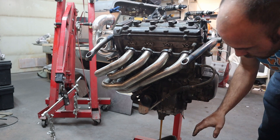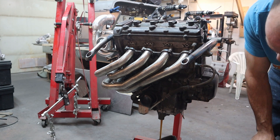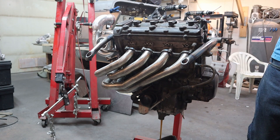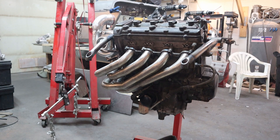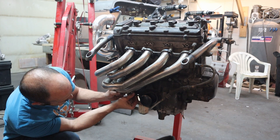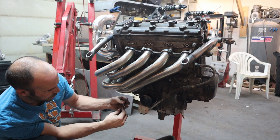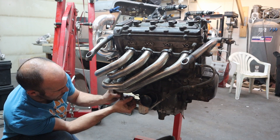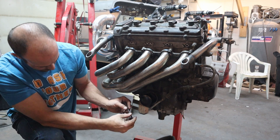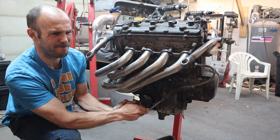This should be overfull — the guy I bought it from said he just overfilled it and every couple of months he'd turn it over, because that definitely looks like a lot of oil for a bike this size. The dry sump kit comes with a plug for the oil cooler line, because you can't run it the same way the factory one is run. And for this line, it's attached to the pan, so the new pan doesn't even have a port there.